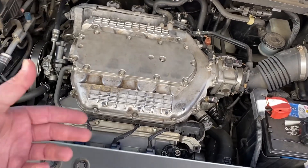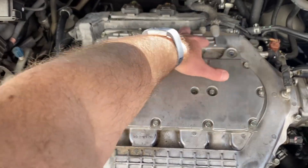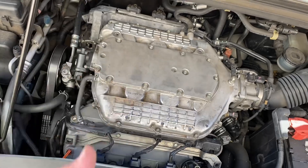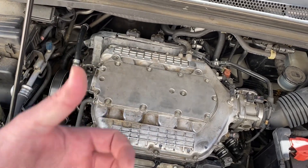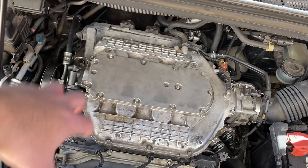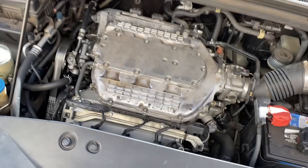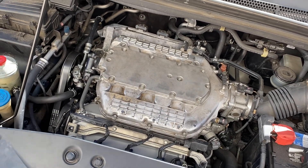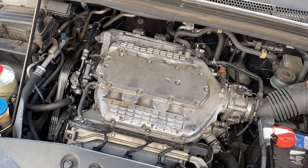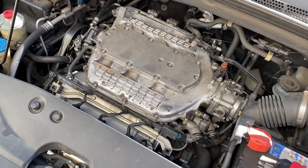The problem is that with those three cylinders deactivated in the back, oil starts to fill them up. It burns oil, leaks it, and causes valve cover gaskets to start leaking and consuming a lot more oil. In extreme cases it can cause a hydrolock situation and actually cause a piston to crack a rod. That's an extreme case.